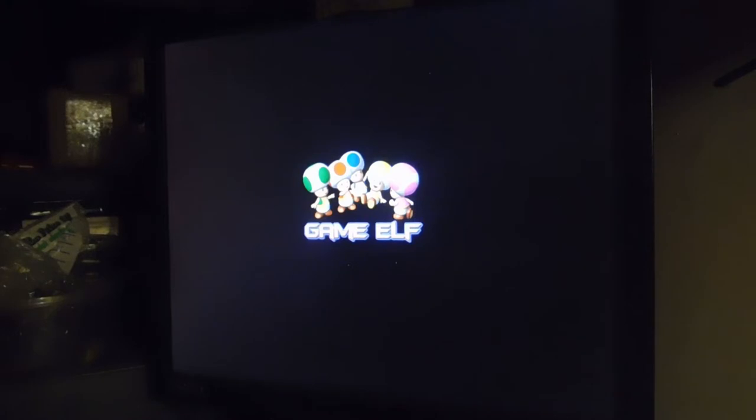Alright, now that you've seen the layout of the circuit board, we're going to go ahead and power this board up now and then show you how to get into the main test menu. There'll be a prompt on the screen that says press test button to enter menu or something along those lines, but once you see the press test button message come up, you just press the test button. It'll flash by really quick, right there. Press test to go to setup. Takes a second to load.